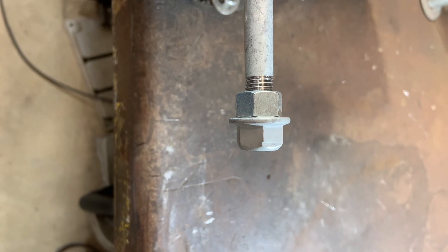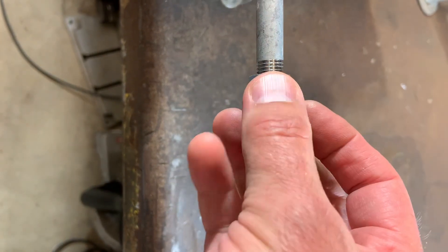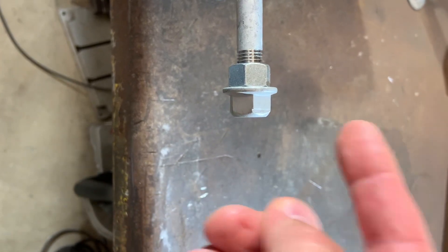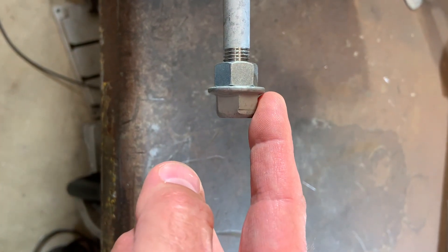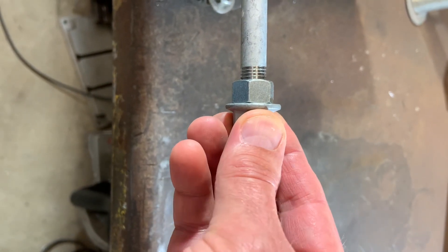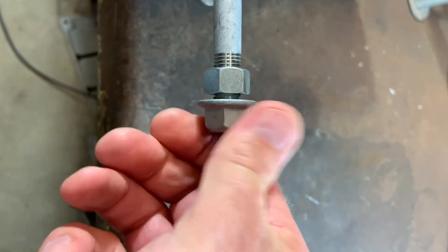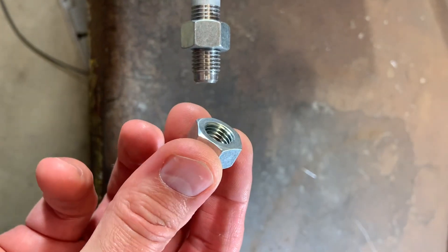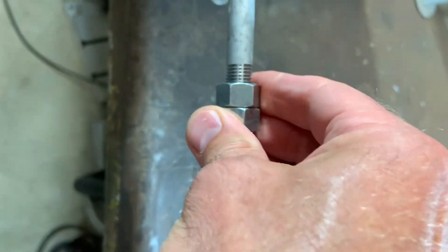Here's some additional information and a clarification. I was talking about how you have the jamming nut and the collar nut and you jam them together in order to screw the unit up into the subframe mount. If you have the VINspar kit with the front gusset cups and the rear bar, there will be four collar nuts — all four go on the top. So when you're doing the front gusset cups you'll still have two of them and therefore you can use one of them as the jamming device. If you bought just the front gusset cups, in that kit you will get two ordinary nuts, and in that case you jam those two together.